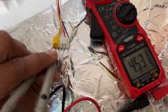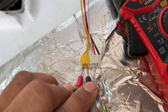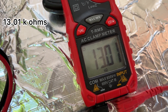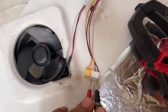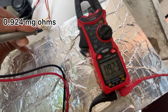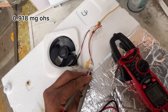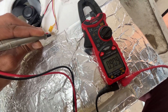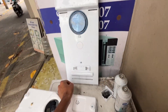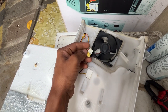I am going to explain how to clear it and check the sensor. The sensor value is 4.5 kOhm — that is the temperature. The fan value is 13 kOhm. If you have any Samsung machine, it is the same value. The sensor value is 0.900 kOhm — you will see the sensor value.